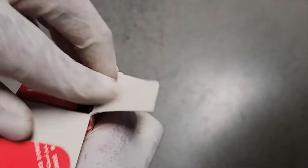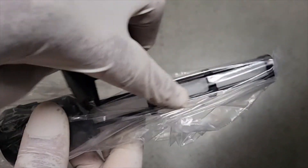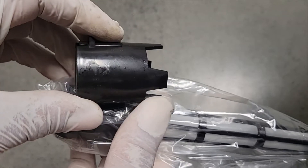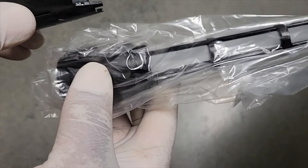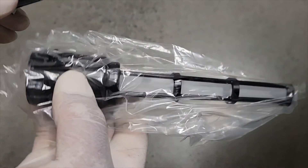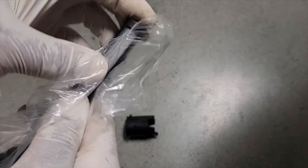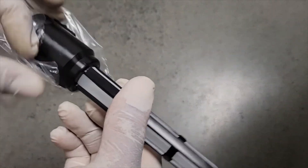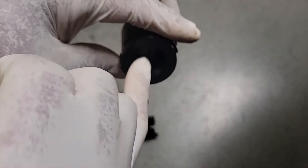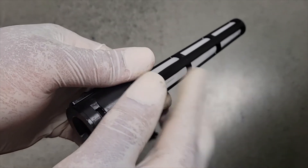I want to show you what I'm concerned about. See? This is what's missing, so it's possible that it could be inside the tank. The manufacturer says you're supposed to check or replace this filter every 150,000 miles or 240K. We're a little bit over 150,000 miles. May need to check it more often. I'm thinking if it was on there, the reason it's not on there now is because maybe when the driver stuck the nozzle inside the filter, it actually broke off the strainer.